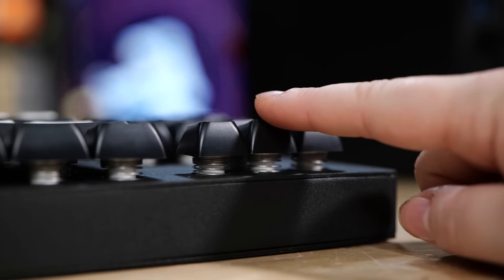See, the problem is that the USB-C connection doesn't actually specify the keep-out zones for that, and so depending on the USB-C cable that you get, you can have some that are really fat, some that are really thin, some that are sized weirdly, some that have extra big finger grips on the side, and then you might have trouble inserting an arbitrary USB-C cable in here. But for peripherals like this, I just don't think that USB-C is the appropriate connection. It's a really minor nit that hopefully the editor has cut down to be way less time than I actually spent on it. I just think that USB Type-B is a more appropriate connection, unless we're in a situation where there's a whole bunch of other stuff in the keyboard other than just the keyboard. And then, okay, yeah, maybe 10 gigabit makes sense.